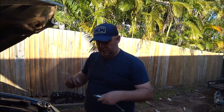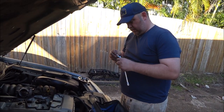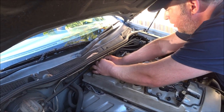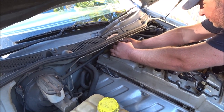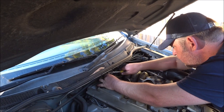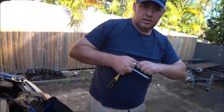You'll need a telescopic magnet or something to get down there and fetch it if you don't have the right socket. Inspect your plug — looks fine. Put that back in there. Get it in on the angle again, make sure we don't cross-thread it — nice and gentle, getting it started. Wind it in as far as we can by hand. This one you'll need to go a little bit further so you can get the ratchet under these lines. Finish it off — and it's job done.